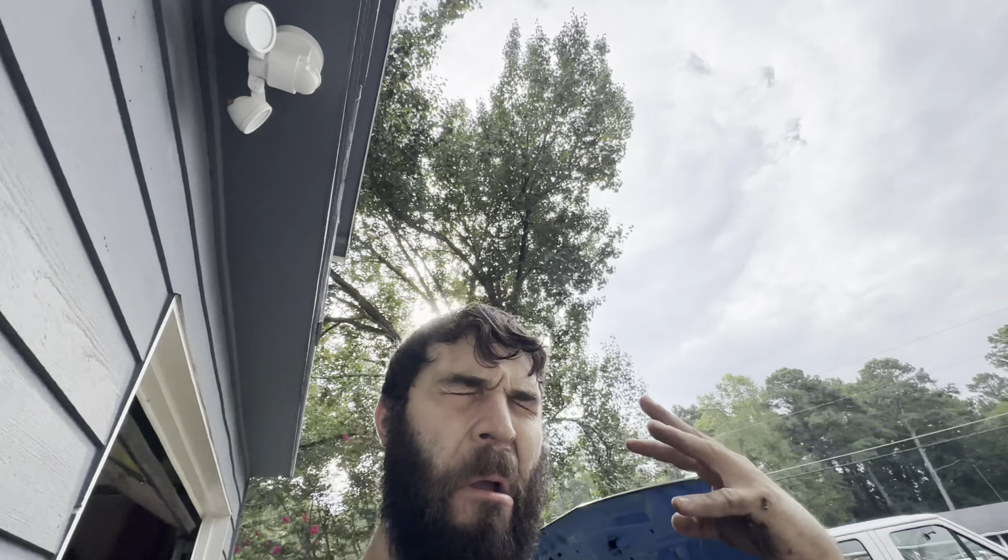The leaf sprung van axle, pretty readily available. These also came four link, not compatible with the car four link. These leaf spring pads are definitely a little farther apart than the cars, but probably within a usable range. And they are a bit wider than a car axle. However, quite strong. So if you had a pre-79 Corolla that's leaf sprung or a wagon that's leaf sprung, this could be pretty quickly a straight bolt in, and most of the vans were 4.10 and 4.3 final drive, which is a pretty cool final drive.